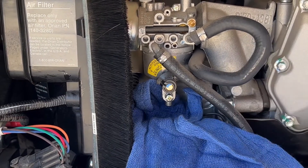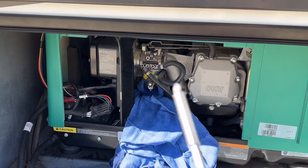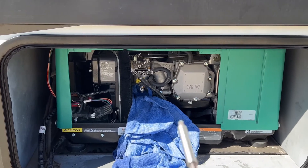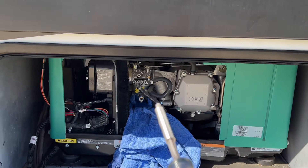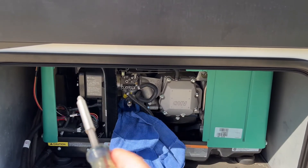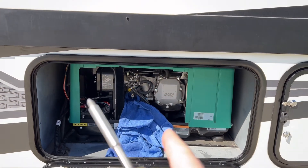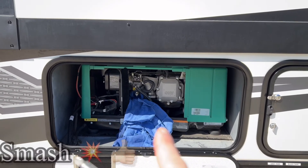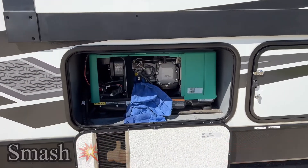We've added fuel stabilizer to the whole fuel system, changed our oil, added fogging oil, and drained the float bowl. Your generator is now good to sit for several months or even a couple of years — though they don't really like to sit that long, sometimes people do put these into storage for a long time. At least now you know your generator is protected. Go ahead and take it to the storage facility or wherever you need. I hope you liked the video — be sure to subscribe.